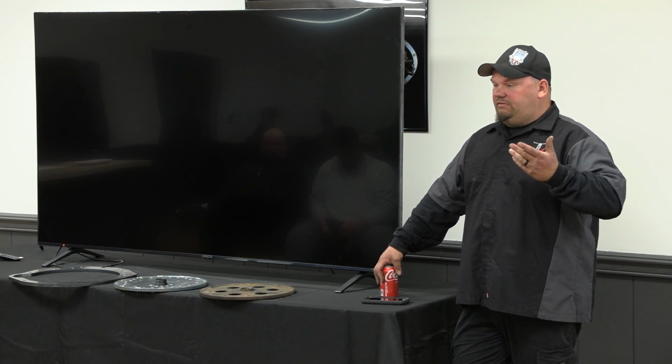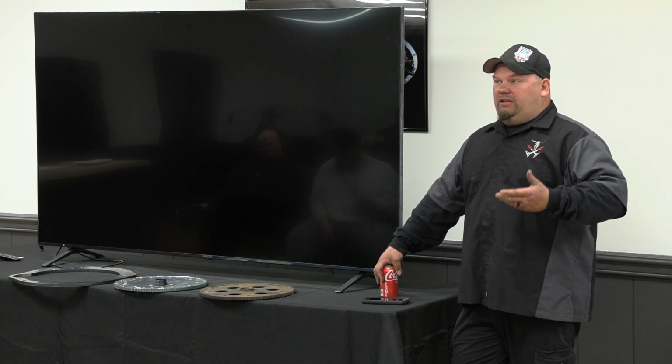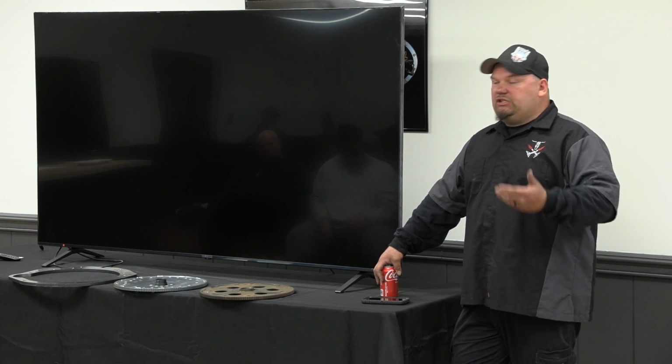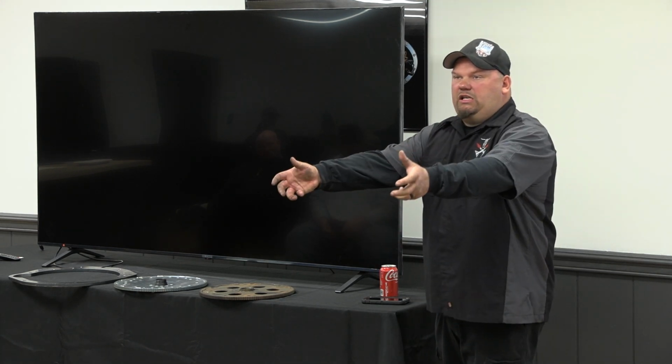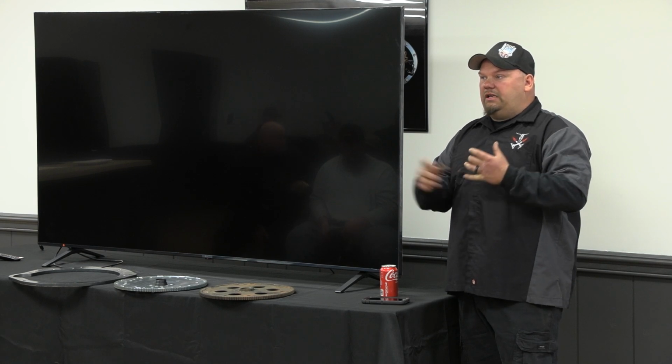It just comes to fluid dynamics and where it's going and what it's doing. And unless you had some crazy 69 302 small block that saw 6,200 RPM, these transmissions were never meant to handle any of that. So it's not about, here's the parts, here's what you need to use. I want to see guys go out, not cook their transmission they just put $1,000 into because they weren't aware, or even their transmission guy didn't know.